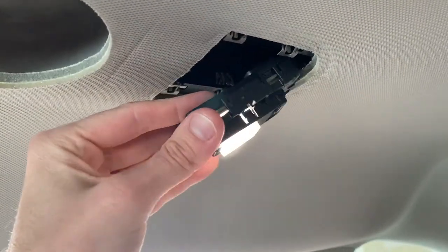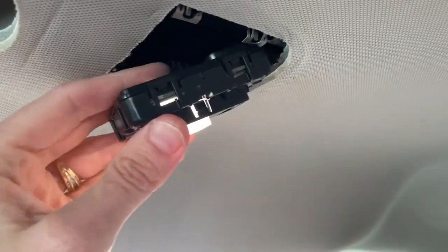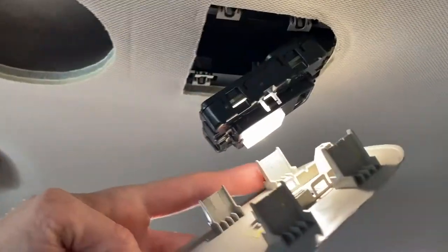DIYers, making progress. Got the entire light housing — it's plastic. You've got electrical wiring on the back side. Make sure your light bulb is down toward the ground. On the back side you've got this little indent right there, and when shifting this piece back up into place you want to make sure you align that properly.